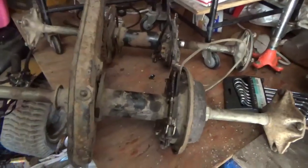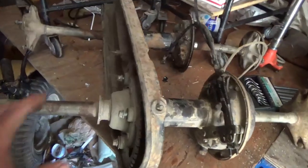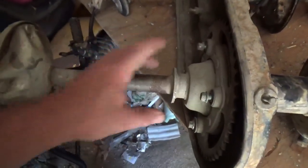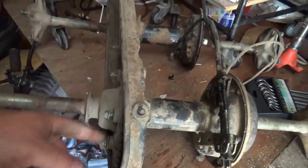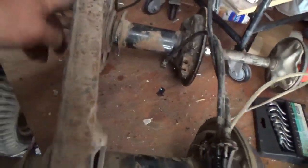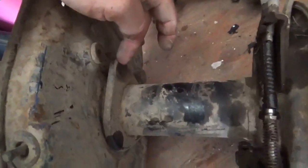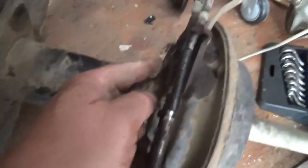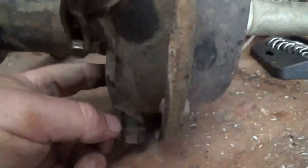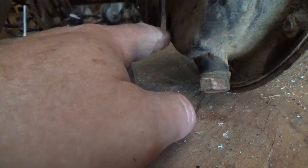Here's a rear axle assembly, and this is from a 200M. And what has transpired here, once again, the hub was off, the cap was off, the guy took the chain guard off, right? He unbolted these from the frame. Then he's got these 4 bolts out. Once again, this bolt, and there's an adjuster on the lower one, not too bad. This bolt frequently comes out. Unfortunately, this lower one, which has an adjuster and all, right, this one normally breaks off.